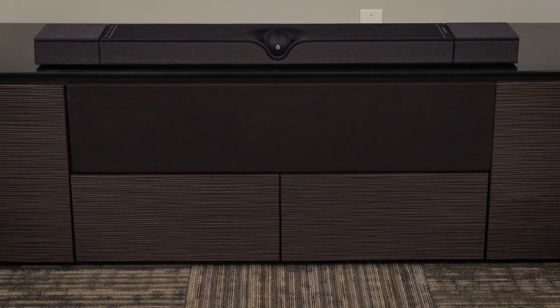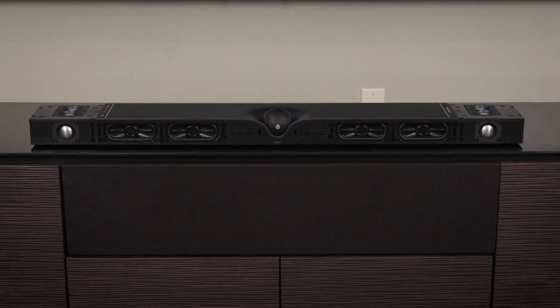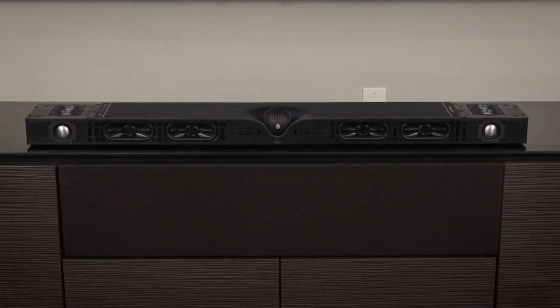Number three is ADE, which stands for Advanced Dimensional Experience. Devialet uses beamforming audio technology to accurately recreate directionality and produce a better soundstage — it's also the reason for the 17 individual drivers. Some of the drivers are set up in pairs, with one being the primary driver and the second used for beamforming. Beamforming is a clever technology that focuses sound waves in specific directions using constructive and destructive interference.